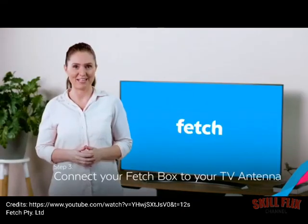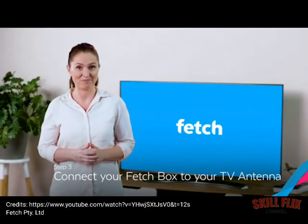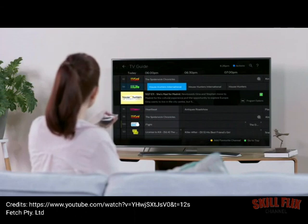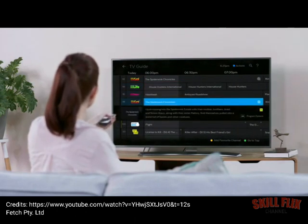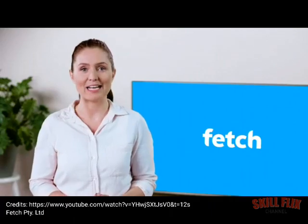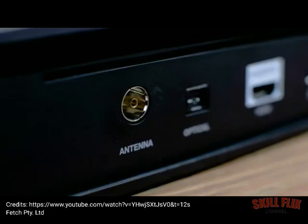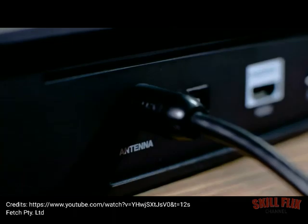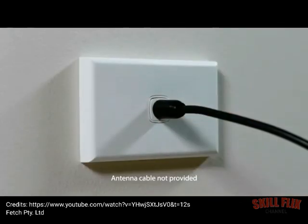On to step 3, where you connect your Fetch box to your TV antenna. We recommend doing this now, as you'll be able to watch free-to-air TV from the one simple Fetch menu. Plus, it'll mean you only ever need one remote to access all your entertainment. Just take your existing antenna cable, plug one end into the back of your Fetch box in the socket labelled antenna, and the other end into your antenna wall socket.